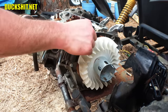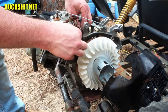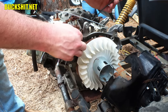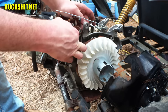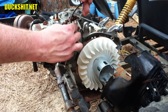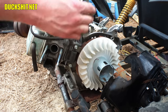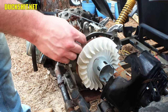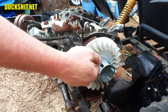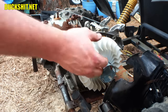These are magneto-based driven ignitions. There is no CDI box, there's nothing fancy about it. There are two wires that come out of this coil: there's a skinny wire which only has one purpose — to shut the engine off, not to turn it on. That wire was rubbing the inside because this sleeve was riding up on it, and it vibrated against the frame and wore through the insulation. This is the whole ignition system — just a coil driven by the magnet on the flywheel. As the flywheel comes around, it sends a charge to the coil. There are no points on these engines. Really as simple as they get.